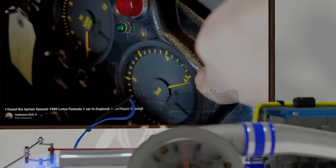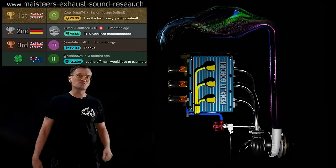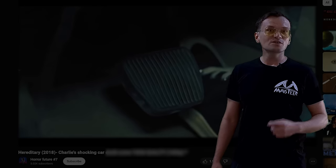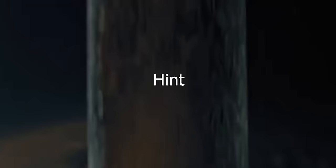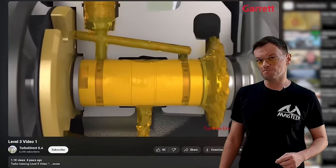But as soon as the driver lifts off the throttle and the boost drops, the DPV curls up. It's important to know that the main throttle is kept halfway open — always — so the engine can keep sucking air out of the entire intake system until there's almost no more air left to suck, just barely enough to keep the engine alive. These turbochargers at full power spin over 2,000 times per second. That's so fast that the outer tips of the tiny compressor wheel could race a fighter jet. Air resistance gets so high so quickly that a turbo spinning at full speed loses most of its momentum almost instantly. But if you take the air away, the only thing slowing it down is bearing friction, and that's just not that much.